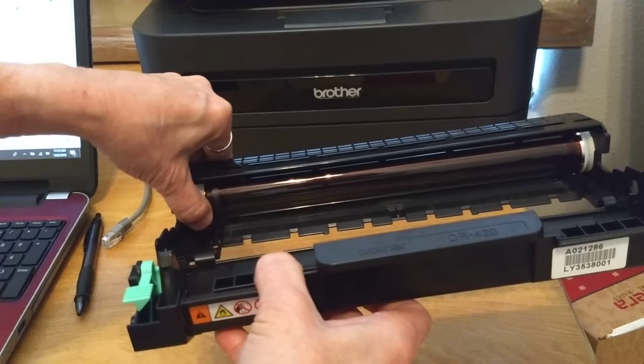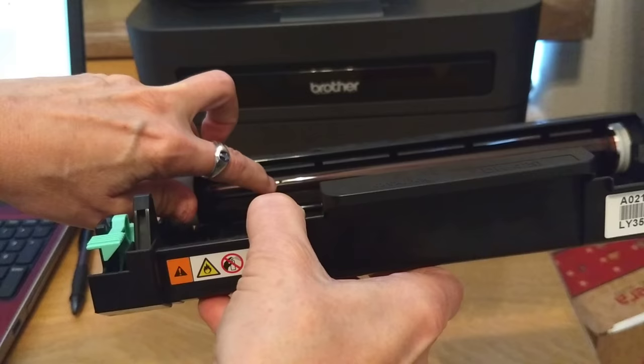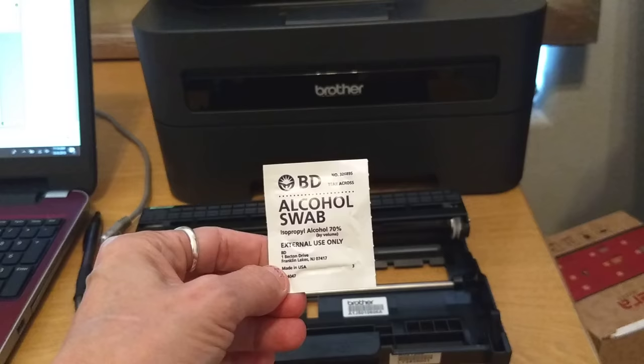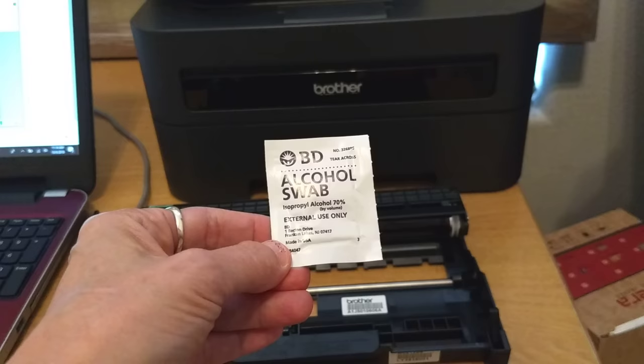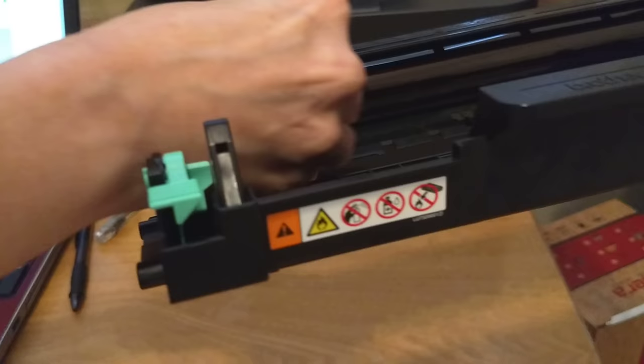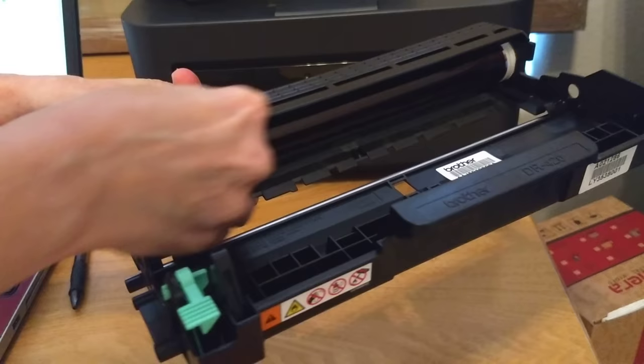We don't want to scratch it. You can turn it to clean it using the gear on the left. I actually have a little debris — a little dot right there — so I'm going to go ahead and clean that up. I'm using one of those medical alcohol pads, 70%, and like I said, use a soft cotton cloth if you don't have one of these. I'm just going to proceed to clean that debris off the roller — I felt it pop off very quickly — so I'm just going to keep rolling the roller and clean the whole thing. You want to let it dry before you pop the toner back in.